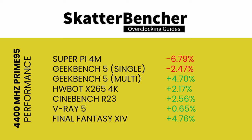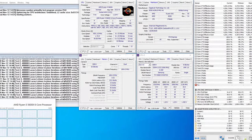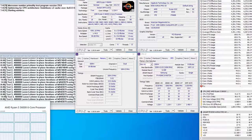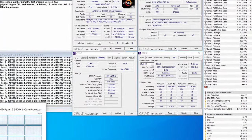For manual overclocking, in addition to overclocking the CPU to 4.4 GHz, we also enable XMP in synchronous mode. This is the highest setting stable for Prime95 with AVX. We re-ran the benchmarks to check the performance increase compared to default operation. Running Prime95 Small FFT with AVX enabled at 4.4 GHz, we're seeing a peak CPU temperature of 93°C and a peak CPU package power of 102 watts.